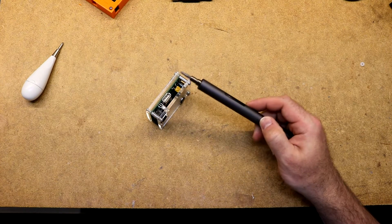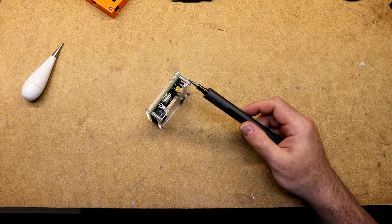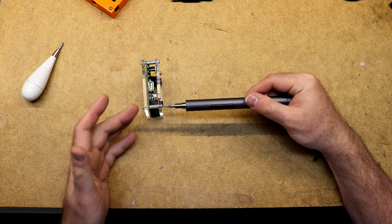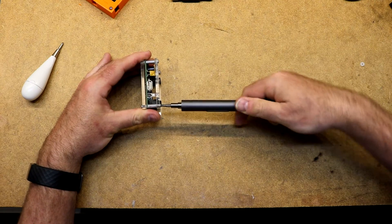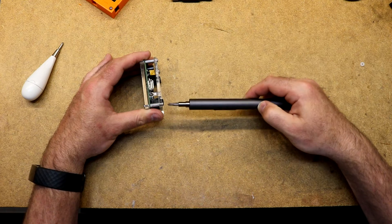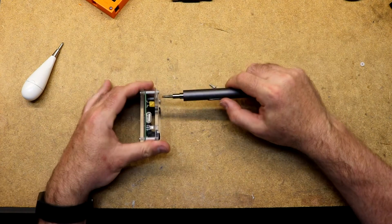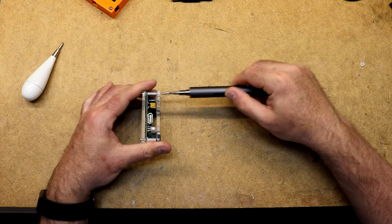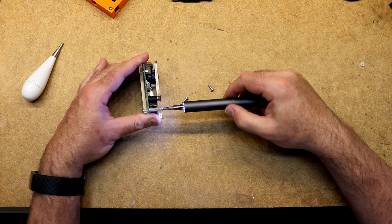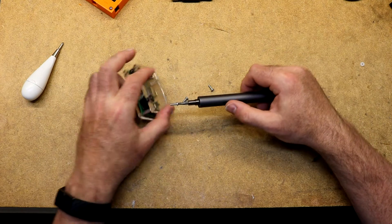That's understandable because this is a precision screwdriver — it's not really designed for lots of torque. It's got a relatively small motor, meant to unwind machine screws to save you the tedium of turning them by hand. So if you have a really tight fastener like I've intentionally made here, you can stick it in and manually turn it — just like a normal screwdriver. But once you've broken the initial torque on the fastener, push the button and it'll spin the screw out. You can probably see I'm giving it just that little bit of initial oomph with my wrist to break that tight seal. It's really convenient for pulling things apart like that.